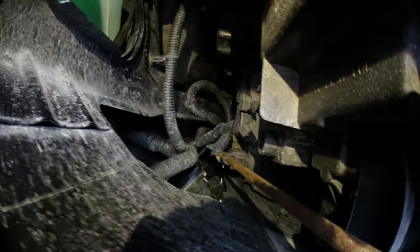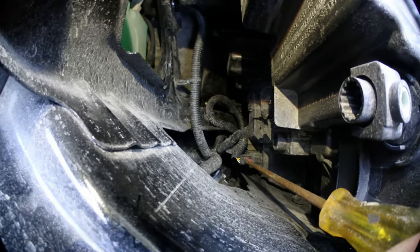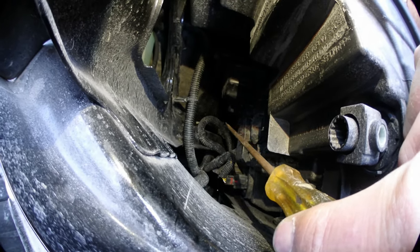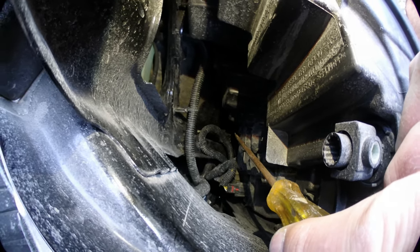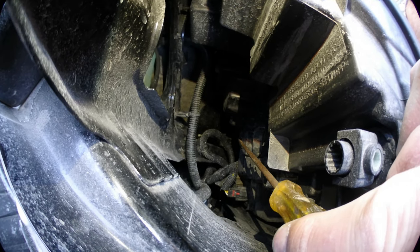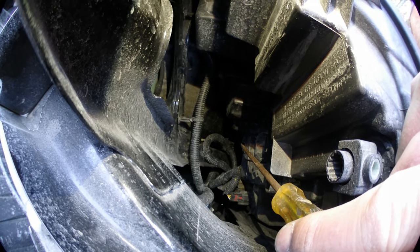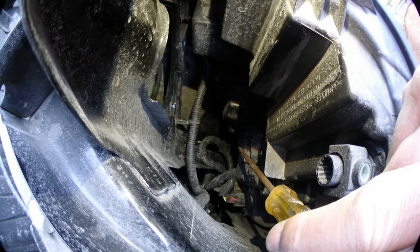You see the plug at the tip of my screwdriver — it's not this, it's the tab right here. I hope you can see this. There's no wire on it, so there's a plastic tab. You turn it about one-eighth of a turn counter-clockwise, and you pull on it, and the bulb is there.